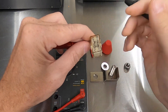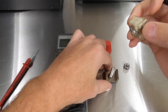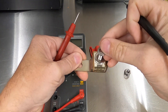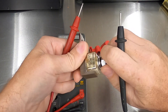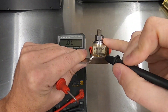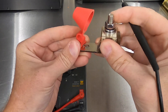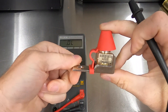This fuse has two terminals — connect one side to each, and it's good. Remember we have no continuity right now on the terminal block. So if I take this fuse, put it on here, go ahead and put our washer on, and tighten this down — at this point I will have continuity and I have 300 amps of fusing. And I know it's not going to jump the dielectric gap once it blows, because this is a 58 volt fuse — it's going to take much more than the 14 volts we have in the car to jump it. So you've got your fuse on there, you've got your cap, and that is a fused battery terminal.